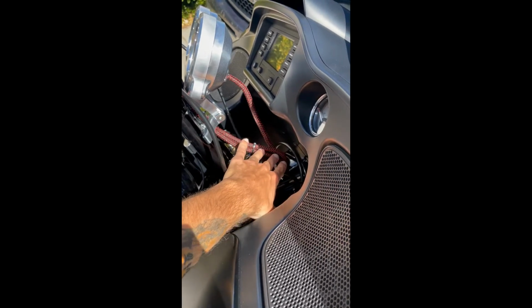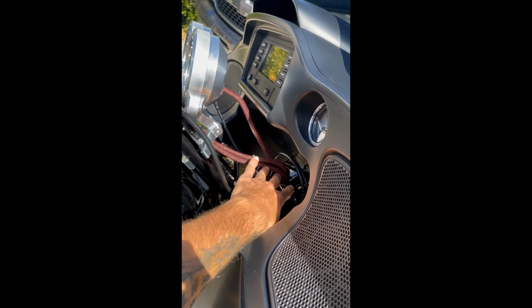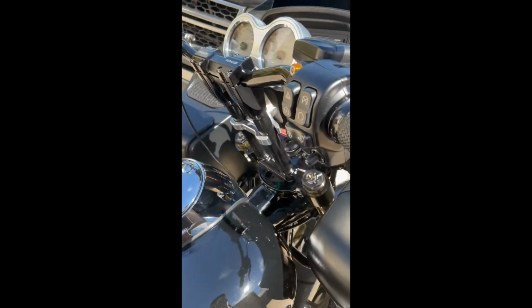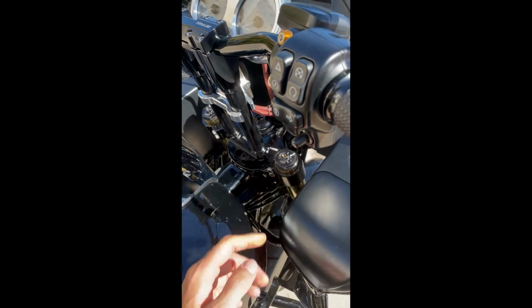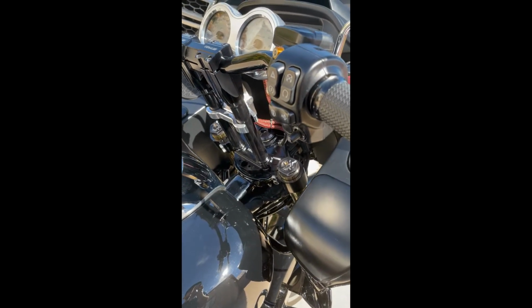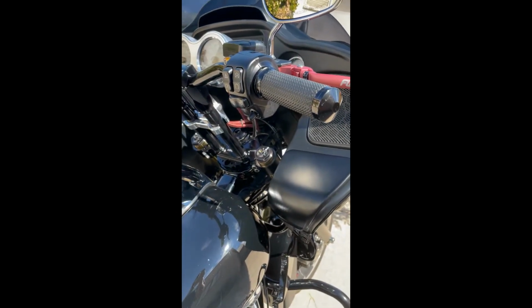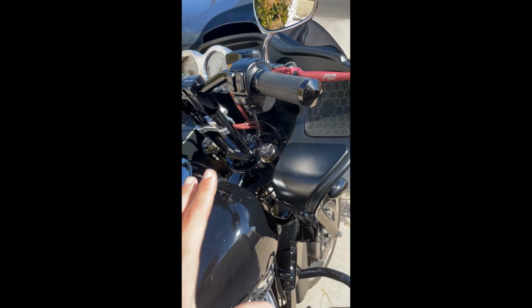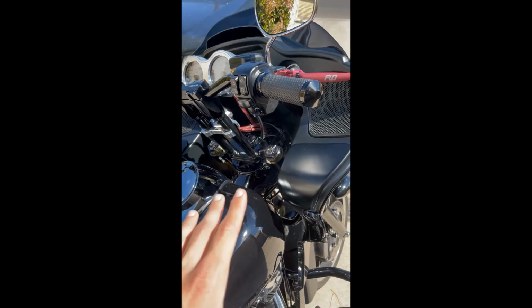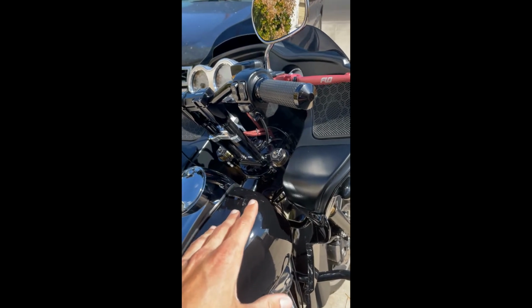Tighten up your pinch bolts. I believe Kraus calls for 20 foot-pounds of torque on these, and then your factory manual calls for 14 to 18 foot-pounds on your fork pinch screws. So what I normally do is go middle of the road with 16 foot-pounds on these, just so if I ever have to go back at a later date and want to check my torque, I don't have the possibility of over torquing those bolts.